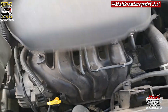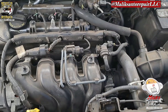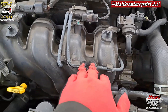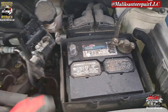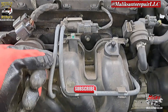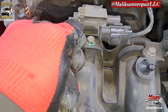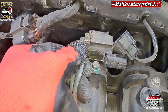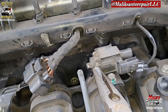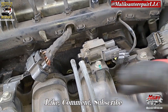I'm going to take off this engine cover — pop it right out, some of the tabs there, pop it out. All right, our lovely intake. This intake manifold, we've got to get it off. I'm going to take off your positive terminal. I'm going to be taking out these wire harnesses, pull that from there. Looking like we're going to remove this from the intake. Got some hoses, probably just remove that — these lines here from this end. Keep that sensor on there. You want to be very careful when you're doing this, because these little nipples can break. So what I do — grab it, just twist it, come off. If that breaks, you'll be paying for another one.